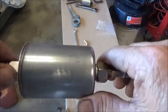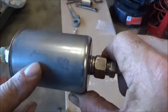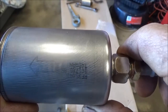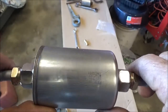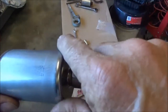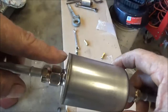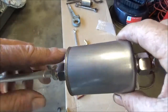While I was turning this, I realized I'm wiping the ink off that has this arrow painted on here. I don't know if we can see that. Yeah, we can see that. Yeah, that's the direction of flow. So in case I do lose that, I'm just going to memorize that the way they had this direction of flow is that this rounded end is my inlet end, and this sharper welded end is my outlet end.